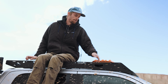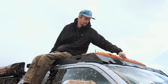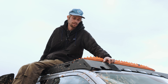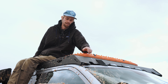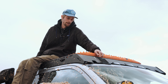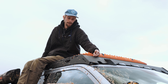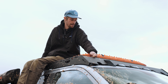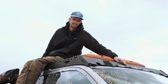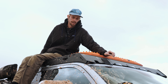The next notable thing I want to jump into is our wind fairing. This wind fairing is designed for the cab lights, so it has a lot of cutouts to accommodate all these lights. We're working on releasing a version to work with trucks that don't have the cab lights, but it's still going to clearance this antenna and your XM antenna on the other side. Something unique about this fairing is that it doesn't have a crossbar behind it like most of our fairings do, just because you can't fit it with this antenna. This fairing bolts into the side plate with some bent tabs on the side, has a bent lip on top for structural rigidity, and a little bracket in the center to give it rigidity in the middle.